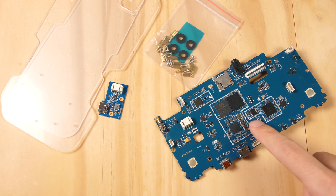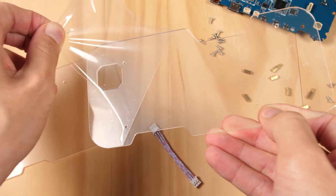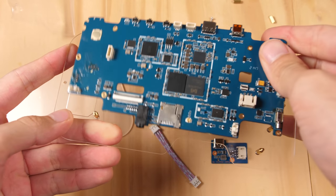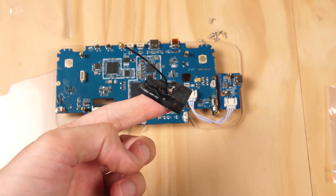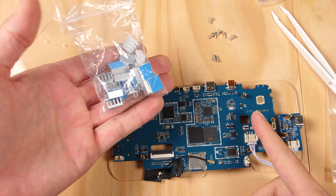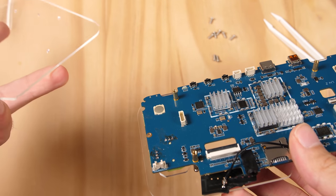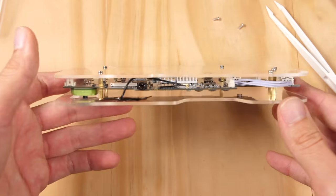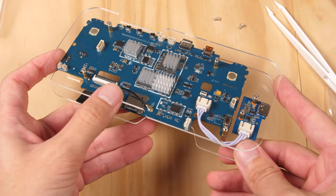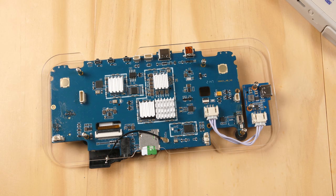I started filming this next section excited to talk about making a console out of the PCB kit that comes with the RP2 DIY upgrade. I think a lot of people have been sleeping on how good this hardware is for gaming at the price point of $65. For that money, you are getting a Cortex A75 CPU, which is much stronger than the types of Android TV boxes that you can buy for the same amount of money. At this point there are no other good Android TV boxes that can compete with this, so I thought this was an exciting affordable home console opportunity — but I found one problem after building the entire kit. In their infinite wisdom, Retroid forgot to check or ensure that this self-contained DIY kit has the ability to work on the PCB that it comes with. Unfortunately, there is no way to get an HDMI signal out from this board without first installing a screen, which kind of defeats the purpose.